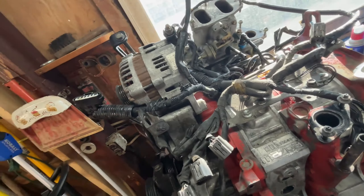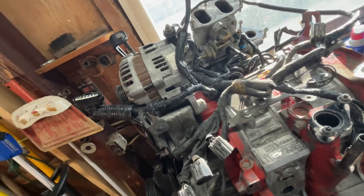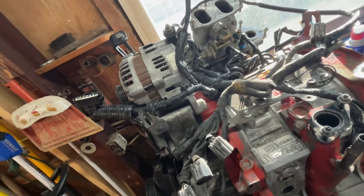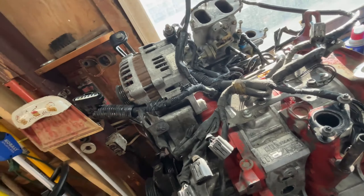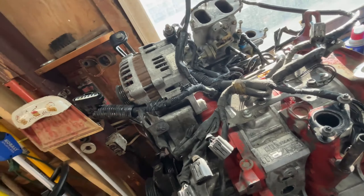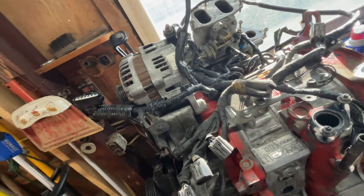We got the throttle body gasket on, we got the gaskets on the rest of — I don't know what you'd call this — the first intake manifold. So the other one is on here and ready to go. This nipple right here for one of the air control valves is going to be a little difficult to get a vacuum line onto, but we can still pretty easily get the fuel line on here. From my second video in the series, this is supposed to rest right about here, so that's already there and ready to go. These three plug into the air control valve solenoids, so they're positioned and ready to go.